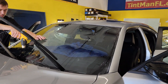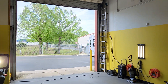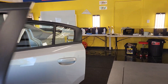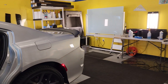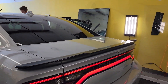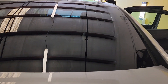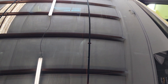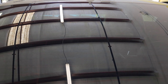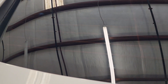What you're going to notice right now is that the car is running and this bay door is open, which we always have closed for install. On these Dodge Chargers they have very thick rear defroster lines. If you don't do a proper shrink and prep and install then you're going to get what's called peanuts — little bubbles that pop up on the rear defroster after you install them. Notice this one has zero.